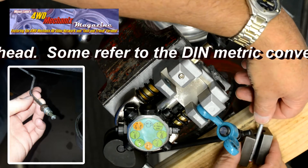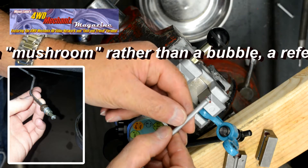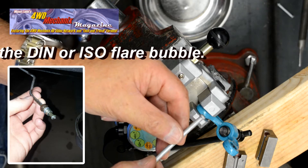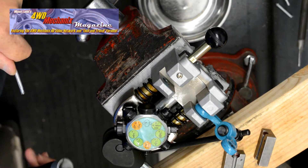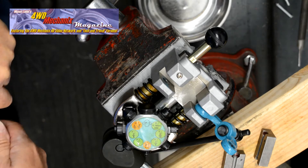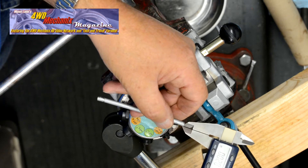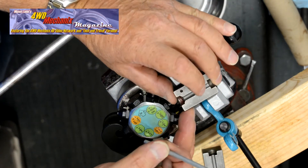Using the DIN metric bubble flare punch, this single step creates a DIN metric bubble flare. Note that the back shoulder is square and the front is a bubble. Always know what type of flare is being used on a system and whether the diameter of the pipe is metric or US measurement. If constructing an actual flare, the flare nut would have gone on first before forming the flare. Once cut and deburred, the flare tube can be measured to see if the wall thickness is uniform and correct. This 3/16 inch diameter tube is 28 thousandths wall thickness, which is normal for non-stainless steel type brake tubing.